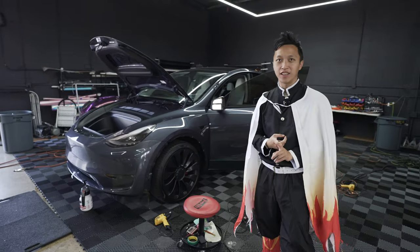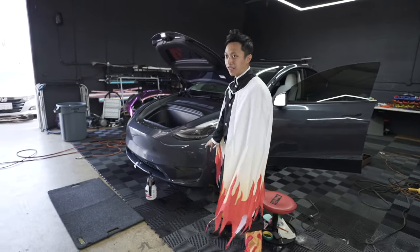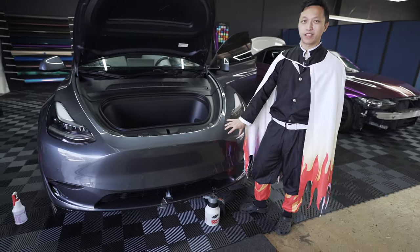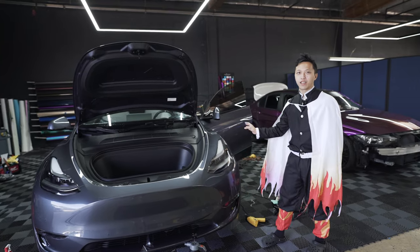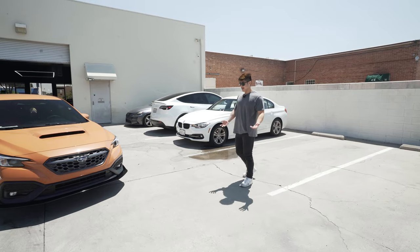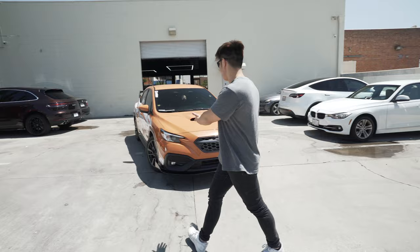Front PPF includes the hood, bumper, two fenders, and two side mirrors. Right now we've installed the front bumper — it's going to take a lot of soap and alcohol to do all this. It usually takes about two guys to do one bumper; one guy can lay down the fender, hood, and side mirrors, but for the front bumper it takes two guys because the material has to be stretched really tight. It was a lot of fun with the whole gang here — we all dressed up in the Demon Slayer livery with the Demon Slayer WRX.